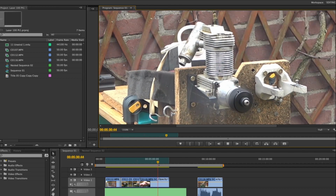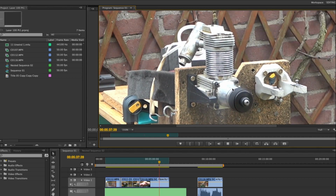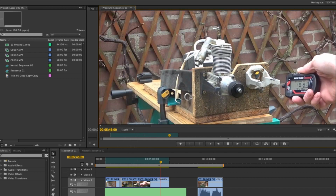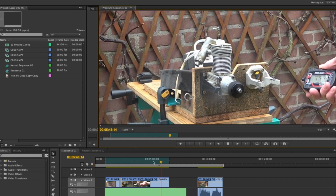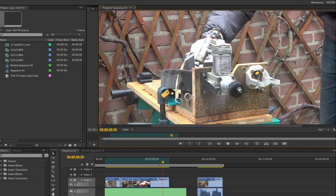And you can see that the front, this is at idle now. It starts to really, really vibrate, probably more than normal. And I should have noticed it sooner then. I'm trying with my tachometer to get a reading now, 1700 RPM. And you can see, lots of vibration. The engines always vibrate at idle anyway, but this is more so because that front housing has already come loose.